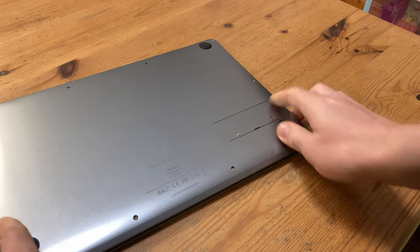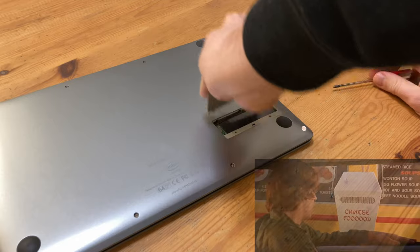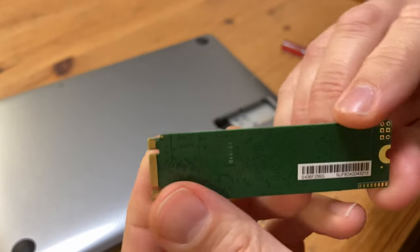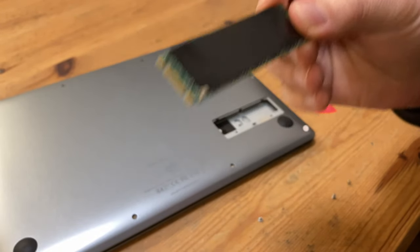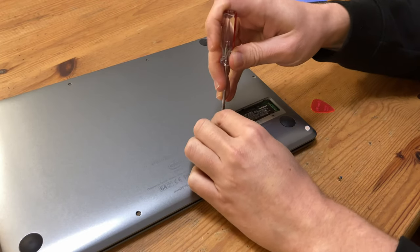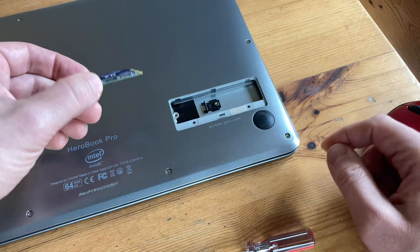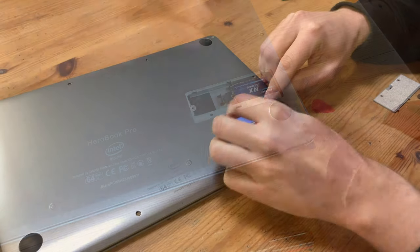Let's take a look at the expansion port. To get in, all we need to do is take out these two screws, then we can flip it open. To remove the drive, take out one screw, then use a guitar pick to pry it up and slide it out. The included SSD is a 256GB AirDisk — it should be seen as generic and probably not very reliable. This is an extremely cheap laptop and you get what you pay for. You can upgrade to a better brand very easily. It supports both 2280 and 2242 sized SSDs. For the smaller ones you need that little adapter we mentioned earlier. We tried a PCIe NVMe but it wasn't detected at BIOS, so only M.2 SATA SSDs are compatible.